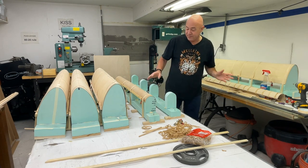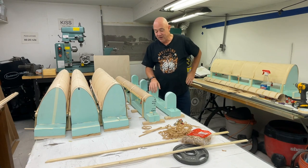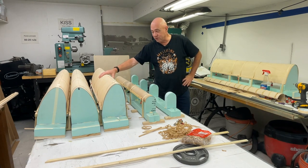The next steps for me are on the wing — I need to get the ailerons working. I've been working on the hinges. When I do a video on the hinges, I love the Air Bike drawings and the way they're designed, but I have some questions on how the hinges were designed because I don't like single points of failure. If one of those end plates fell off, the whole aileron can fall off the airplane. So I'm making sure that three hinges are used such that one hinge could fall off my Air Bike and the aileron would still stay on. Then we're going to do two or three videos of me putting the leading edge skin on.